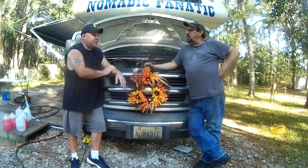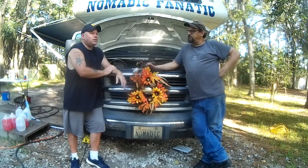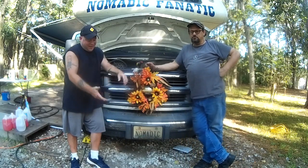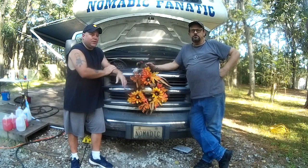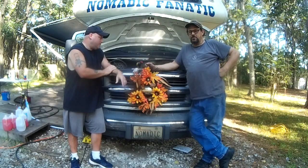And you also mentioned you had a water leak also. Yeah, I've been losing water. I've been putting about a gallon in per 200 miles. Although I don't see anything underneath, I've been losing coolant on the road as well and smelling it really bad once I turn the engine off too.